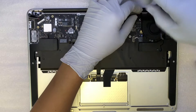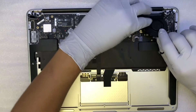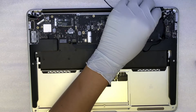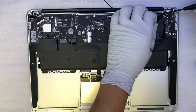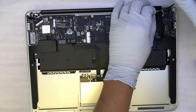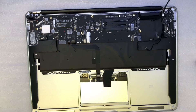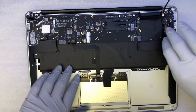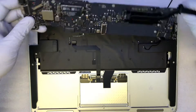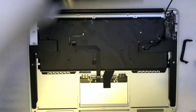Three Wi-Fi cables. I will be removing the fan as well, and this is where that cable is going to come right out. There's one cable hidden right underneath here. Once you have the Wi-Fi cable moved to the back you can go right in there and put the screw in. Pretty much that's it and now we can just remove the motherboard. As you can see, some corrosion is starting to build.